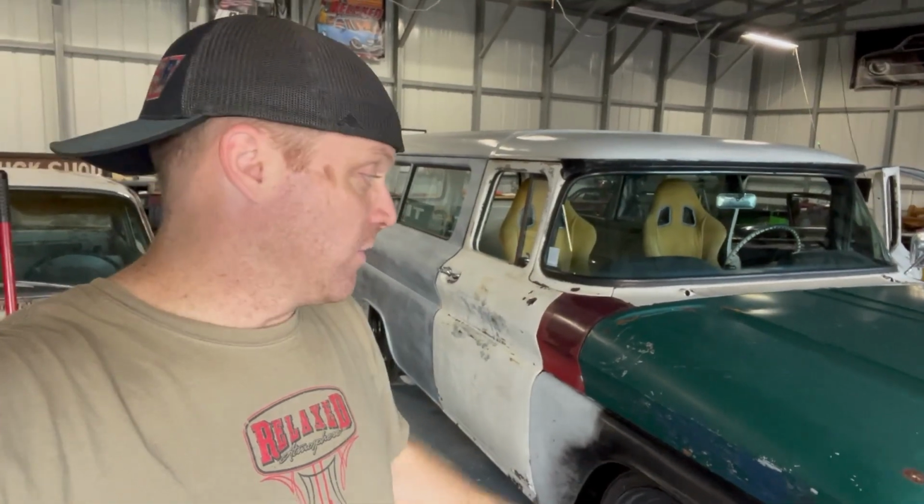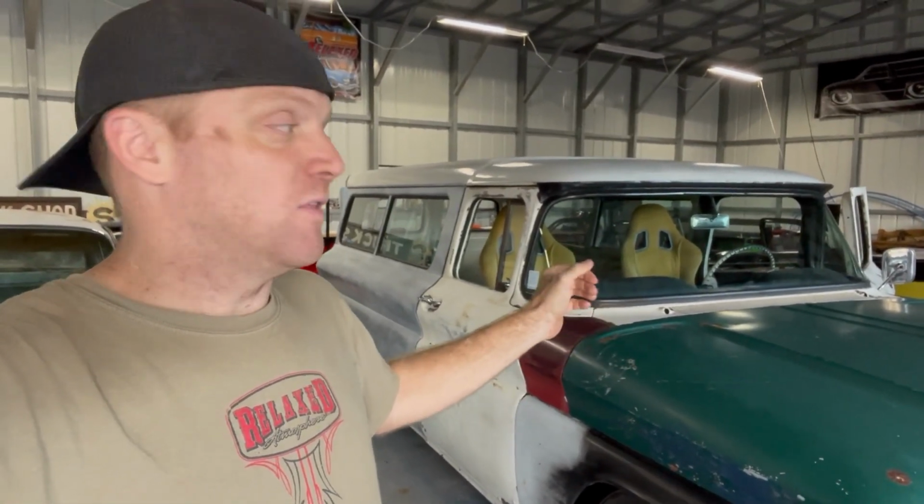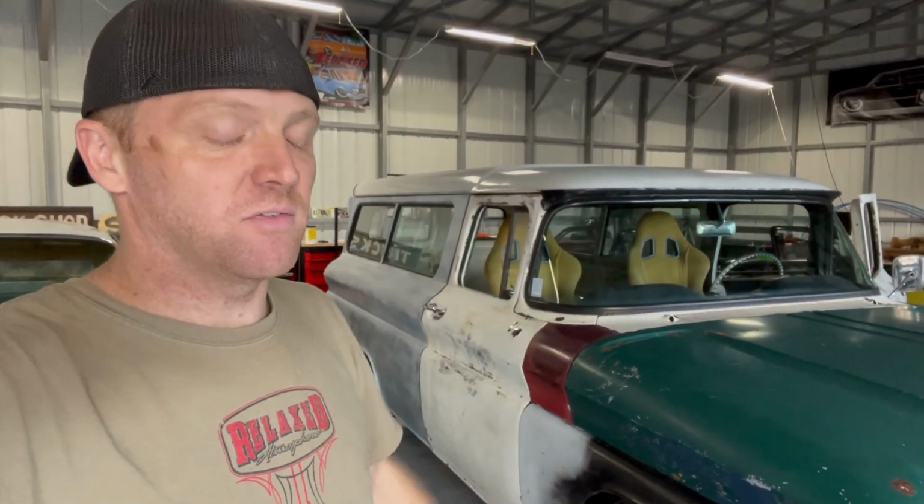All right, guys, well, thanks for watching. Just wanted to show you what some of the differences are for bagging a 62 Suburban as opposed to some of the C10 videos I've put out. As you can see, pretty straightforward in the rear, just a few little differences. Front is very similar to a C10, so not gonna go through that, and Kurt's not bagging the front of it yet, but he is working on getting a new frame eventually. This one is the X frame, so it's got a lot of challenges that really aren't the best, and he's gonna swap it over to, I believe it's a 63 and up, which is like the normal C10 frame.